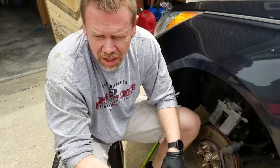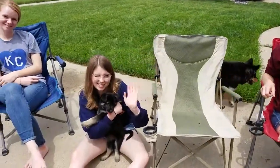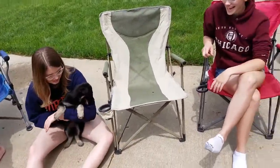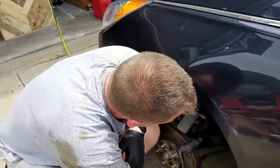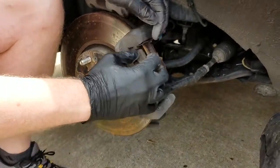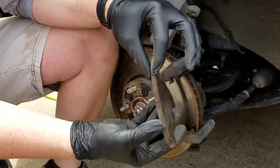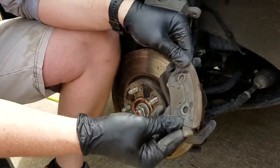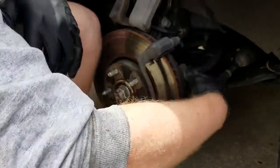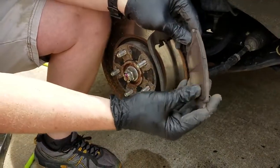I do have some helpers out here today — Mikayla, Mariah, Avery, and the new pup Sawyer. Ashlyn's on the camera. These are actually the brake pads — let's see if we can get those off. See how thin that is? That's actually the pads. Yeah, we need to replace those. So it's a good thing we're doing brakes today. There's one pad — that's about gone. There's the other one — that's about gone too.